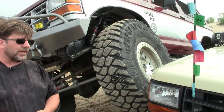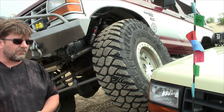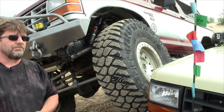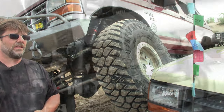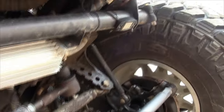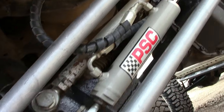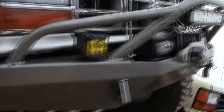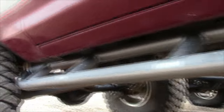It's a C4 trans built by a guy in Westland. I built it first and messed up the forward clutch, so it was time to get it professionally built. It was originally a full-width axle that was narrowed six inches. It's got an Explorer 8.8 in the rear, and the rear is trussed. I've got an anti-rock sway bar on the front and a TK1 sway in the rear.